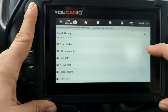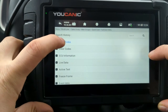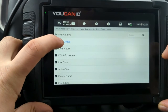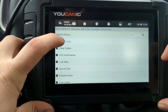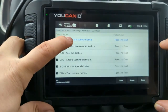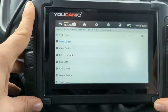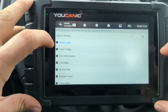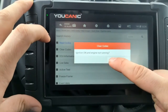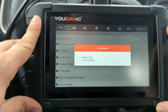Keep in mind this is only a Dodge and Chrysler limitation — it's just the way manufacturers are trying to control how you diagnose your own vehicles. Here I've entered the Engine Control Unit — in this case called the Powertrain Control Module. Some makes call it the Engine Control Unit. You can read codes; no codes are found. If there were, you would normally clear them, but if you're simply connected to the OBD2 port like right now, you still wouldn't be able to clear them.